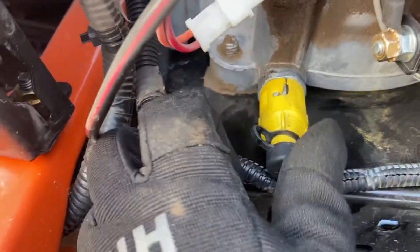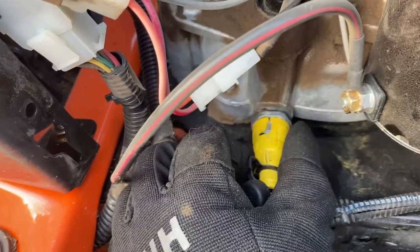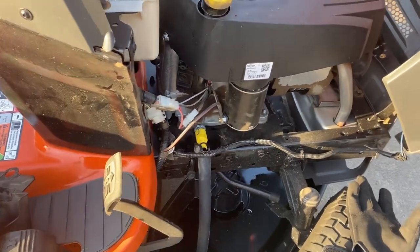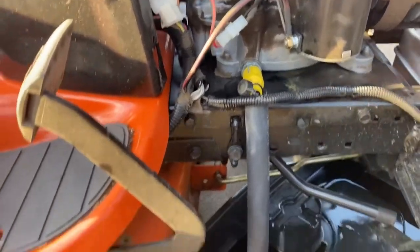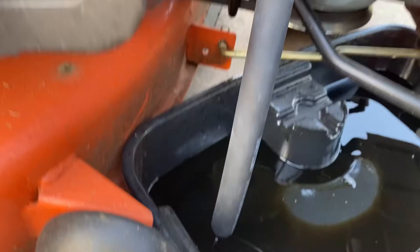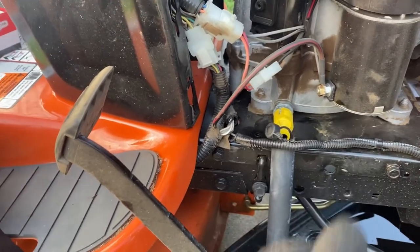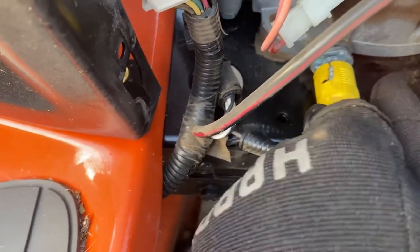So to open this up, you want to take this little cap off here and turn it counterclockwise, then pull it out. I didn't have the hose that comes with the lawnmower — it's a little clear hose that fits right on there perfectly. I just had this piece of extra hose. You can see the oil dripping out right there, just a small little bit coming out, so that's good enough. I'm going to take this hose off now and close that, seal it back up. Pretty easy — just turn it back, push it in, turn it back, and it locks.